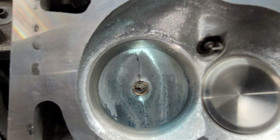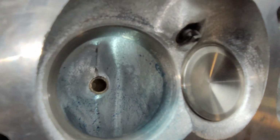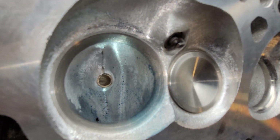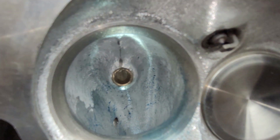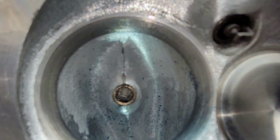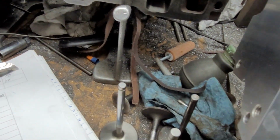That uppercut on the valve job could probably use a little bit of work. I've got my throat set at 88%. I've been working on the short side, how wide the bowl is, and the roof speeds. Let's see where we are right now as far as intake.